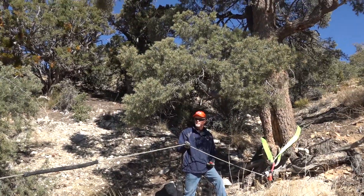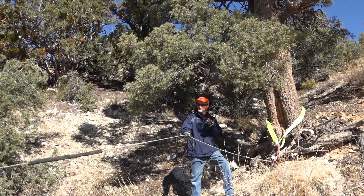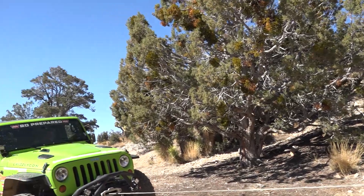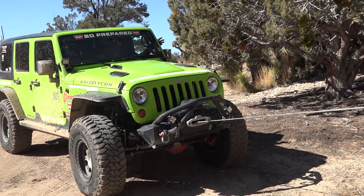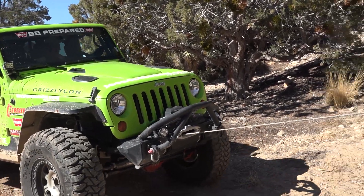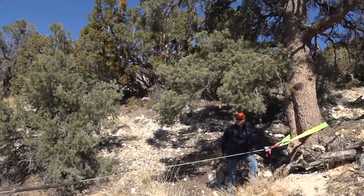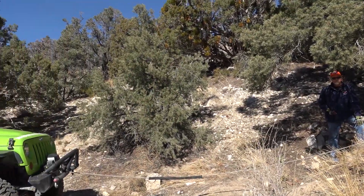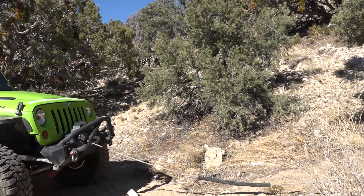When you're doing this, one of the important things is you want to be in gear. I've got my foot on the brake until he gets the slack out. You can see it's a really easy pull because we're not on much of a grade, so the slack keeps coming into the winch line because I could actually idle along faster than the winch is pulling me. So you want to slow down a little bit — ride the brake while being pulled. You never want to leave the vehicle in park when you're pulling somebody else, because that could damage the transmission.